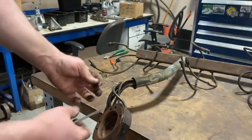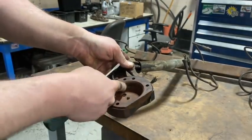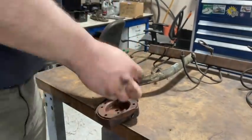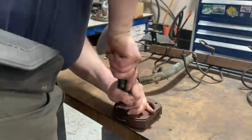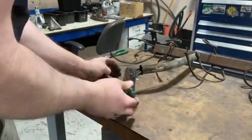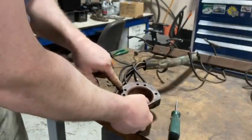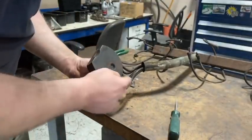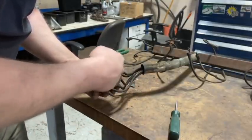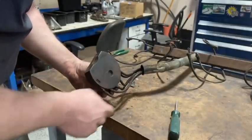So you have to take all these little screws out, and you can slide these wires out of this Bakelite distributor cap. You can see all the contacts are inside here, all the way around in a circle. So number one slides in here and attaches to this screw, which is this contact right here. So number one is going to be in this quadrant up here, all right? So I believe this distributor rotates clockwise, so that's going to be 1, 5, 3, 6, 2, 4, I believe.